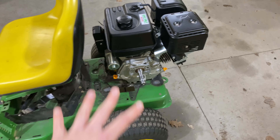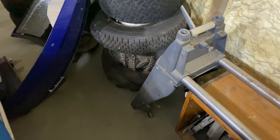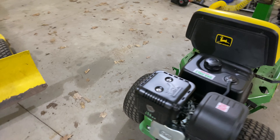The axle on here is three-quarter inch, so I have questions about whether it's even going to hold up to the power. It's not that big of a deal though — I do have some one-inch axle ag tires just chilling not doing much. I might just go ahead and get a one-inch keyed shaft and slap those on there, but I don't have the one-inch bearings.